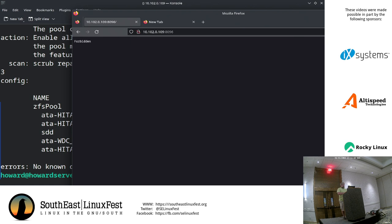Even though it's splitting larger files across drives, if there's a small file, it could end up residing on a single disk, and someone who knew how to access the ZFS file system could get to that. And anything super important, like taxes or my Bitcoin key, I encrypt as a file and put it on there. So encryption for the VDEV as a whole, no.